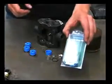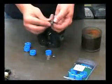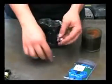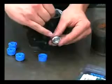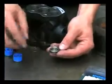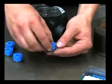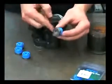The first thing we'll do is install a new set of valves available in a repair kit. If you're reusing the old valves and they look good, just put that o-ring on and make sure this poppet faces this way so that step will fit into this spring. Make sure that's as straight as you can get it, then snap it back together and put a little bit of oil around the outside of that o-ring.